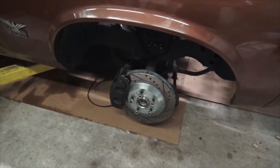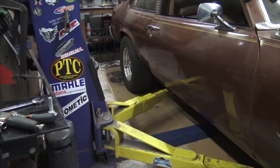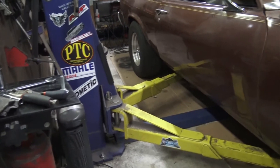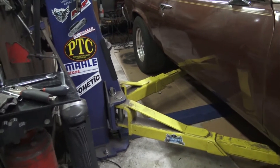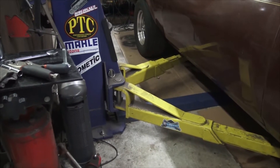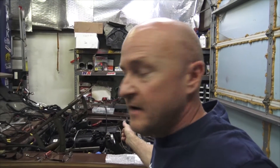It's got Mickeys on American wheels, front and back — 17s up front with 225/55/17s to clear the calipers. On the back we have a Ford 8.8 with 3.15 gears and 31-spline axles — I forget who made the axles, one of those companies. Ford Mustang GT rear brakes. It made 612 horsepower on like 12 PSI of boost off the old smaller AR turbo.